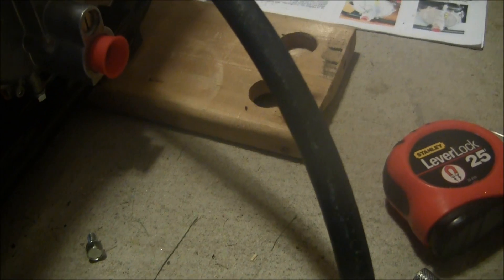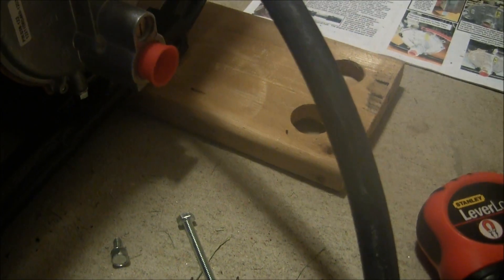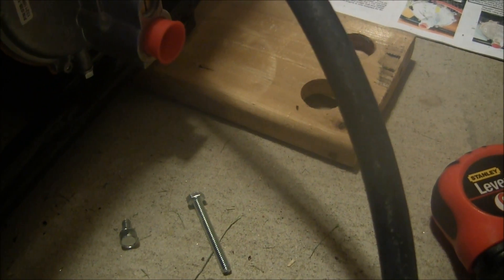The short bolts and long bolts that came with the kit — neither worked with what I think is a 3/4 inch roll bar. The small ones did not work, and neither did the longer ones that came with the kit. So I had to go to Lowe's and bought some shorter ones — I think they were 1-3/4 inch. I was able to use those and now it's secured fairly tight, close to the carburetor as the instructions say, so I'll be able to connect it easily.